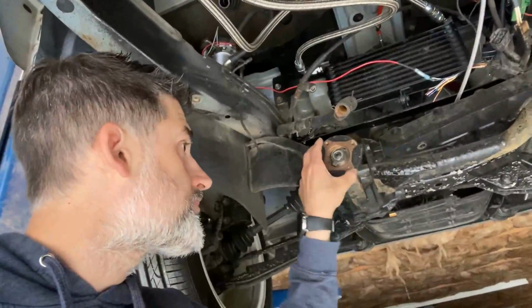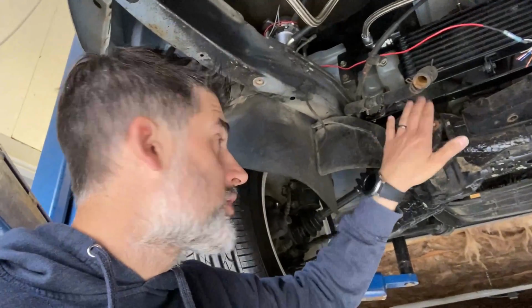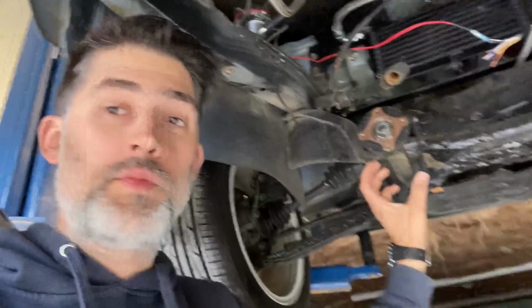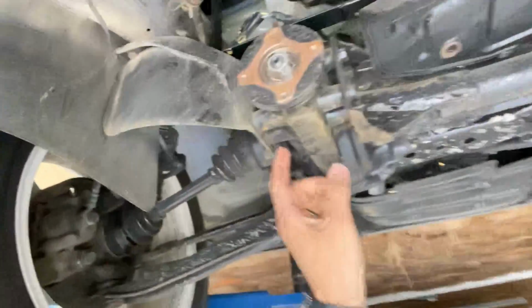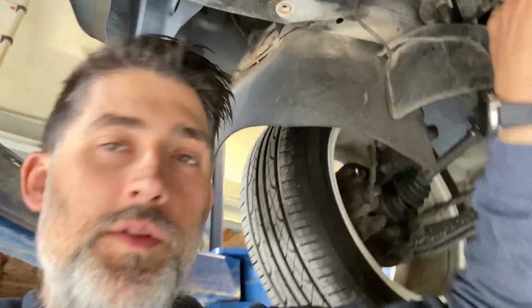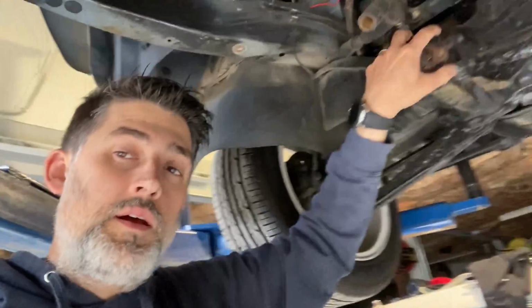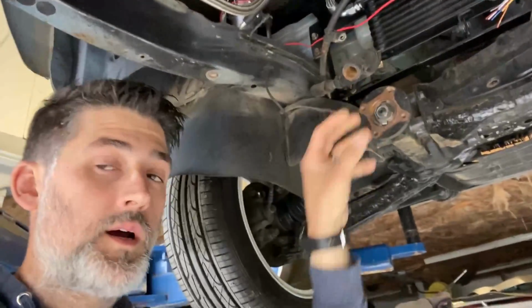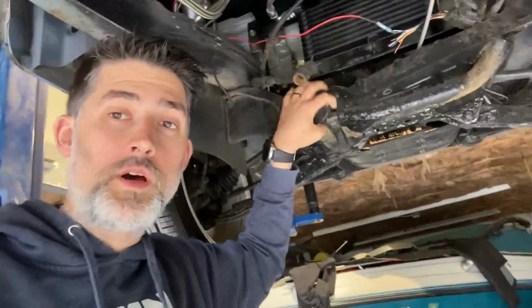Here's the flange for the front diff. This is where we're going to do our reverse. I either need to fab up a starter motor, some type of 12-volt motor, weld a bracket onto the diff housing, and have a motor out here with a gear to turn this. The idea is that's going to be a reverse. And since this is a locking diff, we can simply engage the center locking diff to get this whole section to lock in, because as you can see, it's totally disconnected. Then click a button to power that motor to spin this and drive the truck in reverse.